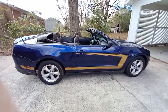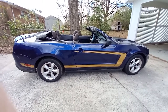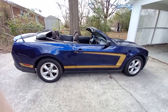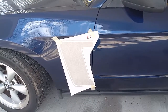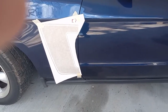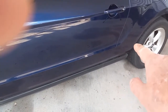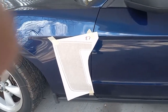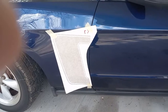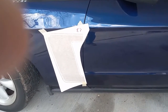To put on the gold, white, or whatever color side stripes you choose — this one is a 2012 Mustang — I'm going to go around to the other side, which is blank yet, and show you step by step what to do. Step two is take the big decal — I call it number three because number one goes on the bottom and number two goes between the door and the rear wheel well. I'm going to tape number one on first so I can line up the bottom strip, then remove it and put the bottom strip on the car so every other piece will line up.